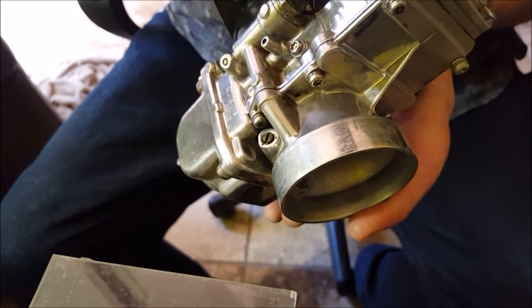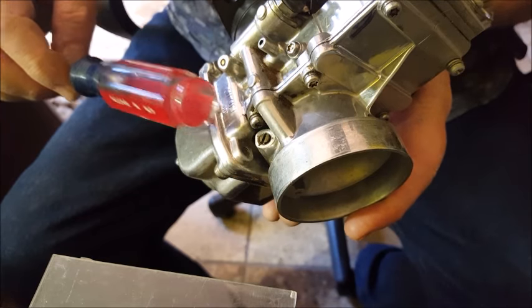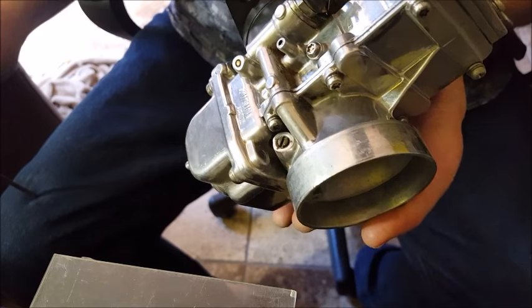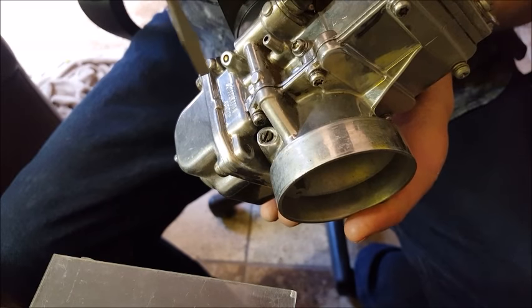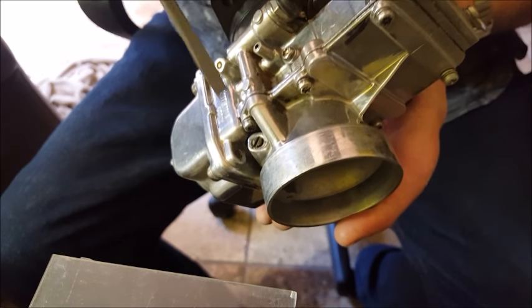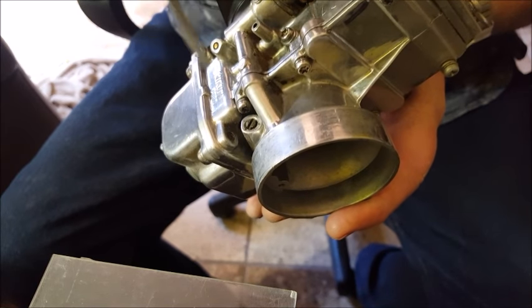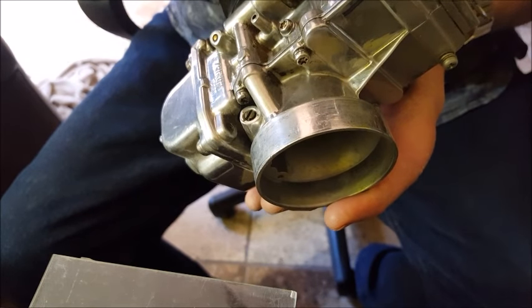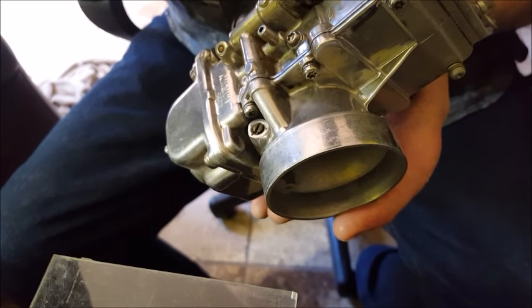If you're having trouble anywhere else in your carburetor, that's something else entirely — it's either your slide cutout, your needle jet, your needle position, or your main jet. A lot of guys try to fiddle with the air screw to fix the mid-range, but that's a roundabout way and it throws off your idle. Once you get the pilot jet the right size and your screw in that one and a half to one and three quarter range, you're done with that. Everything else adjusting the carb has to do with the other circuits, so just leave that one alone. Hope this helps!